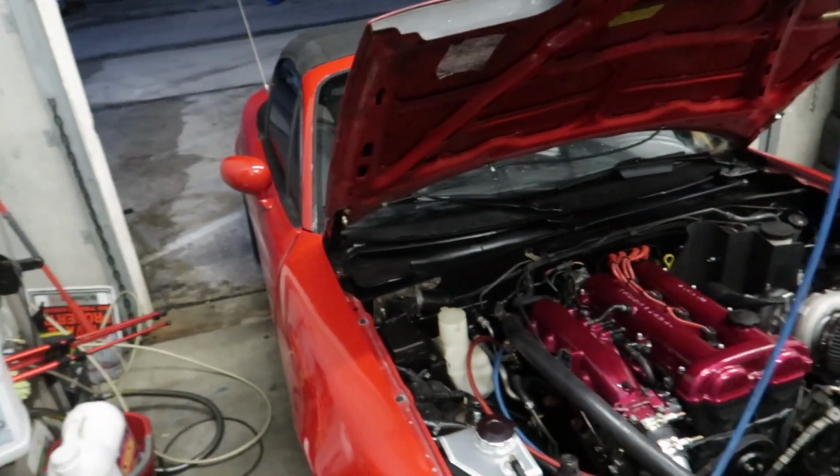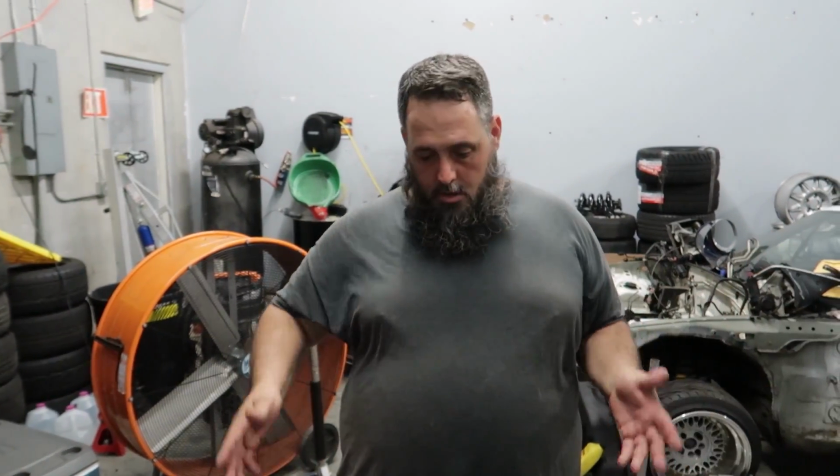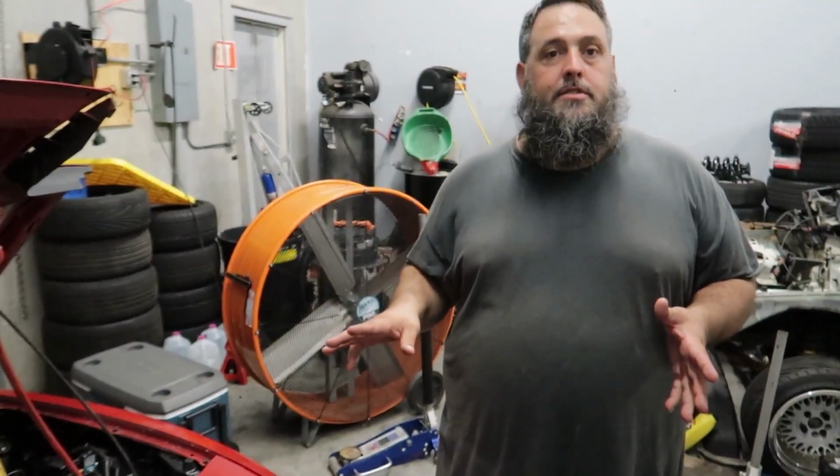So to find the leak now, what's the game plan? The next step is to dye test the system. We'll pressurize your system, we'll put dye in it, so it'll be air and dye. And we'll go ahead and just see what we got. And just hit it with the special ultraviolet light? We'll do it tomorrow rather than do anything else. What I'll do is first thing in the morning, we'll come in here. Obviously the shop will be available. We'll park right here, we'll turn all the lights off. And I'll shoot it into the system.